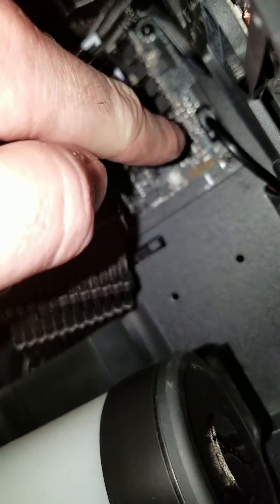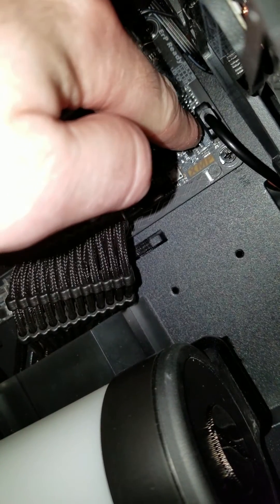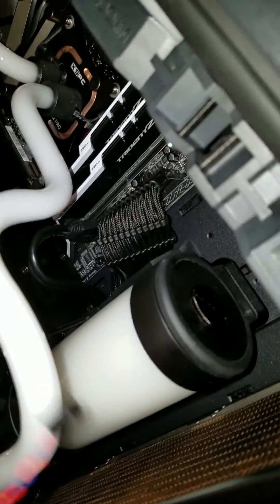This is one of the digital headers on my motherboard. I'm only using two pins: data and ground. Please refer to the manual to get the proper pinouts for your motherboard. Do this properly as I have no idea what 5V will do to the data line on your LEDs.